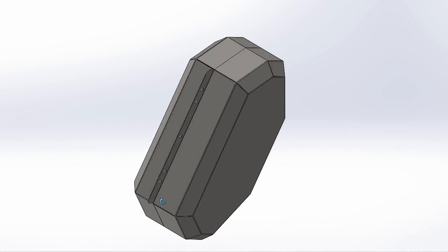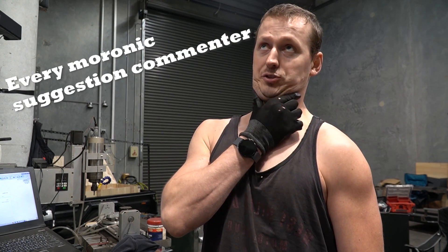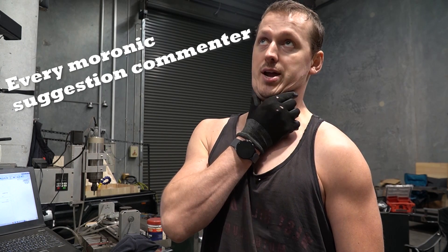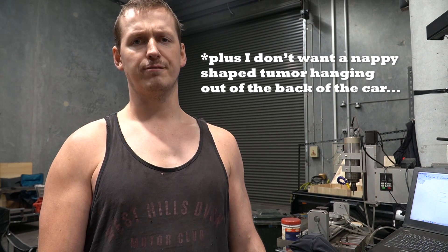Being someone who is slightly familiar with CAD, I've done this — and this is going to be near enough exactly 100 litres of capacity for this V10 Patrol. But why don't you just put a stupidly oversized tank and have 200 litres and unlimited range? Well on computer controlled cars, that's a bit of a stupid idea. Because most of the time if you change the fuel capacity, your computer is going to do funky things — like always be wrong about your range calculations or fuel economy calculations. I'm not sure about in this case, but I feel like that could affect the fueling. Probably not, but I'd rather not risk it. Plus I don't need more than 100 litres of fuel. Fight me below.